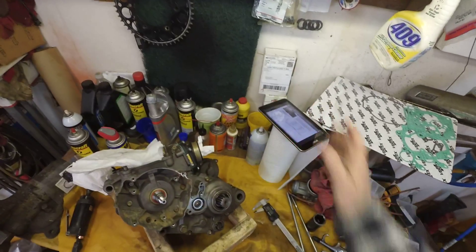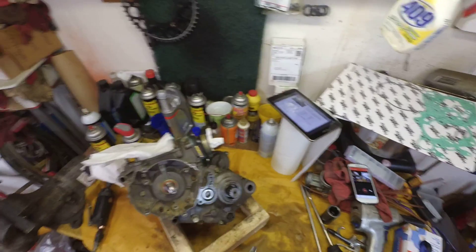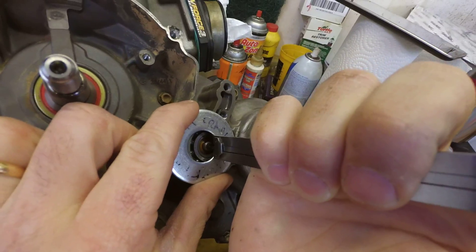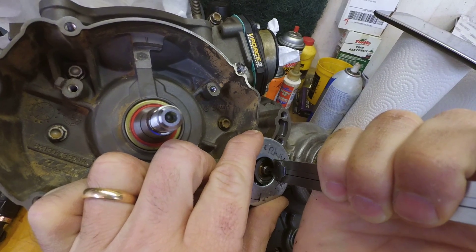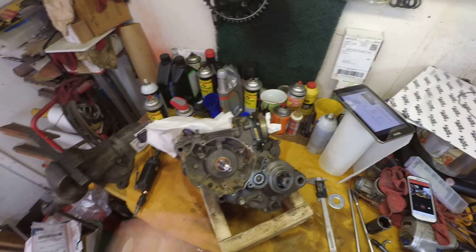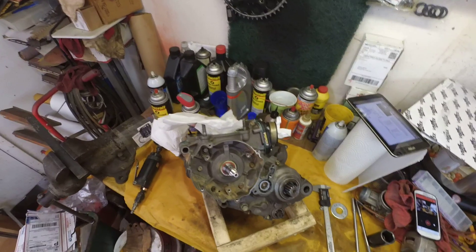So that is how I do the Y Dimension — it is real simple and you can do it with a basic caliper. You just set it up on the surface, zero it, and bring it in until it touches. Don't take shortcuts, use the right gasket and the clutch will feel a lot better. Make sure you bleed it out properly as well. I am going to be doing a video next on the X Dimension as soon as we get the piston in — I have got a couple of tools I made for the X Dimension and we will do that one next.